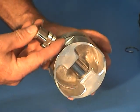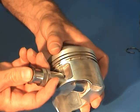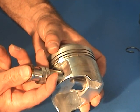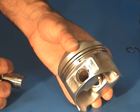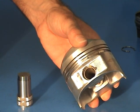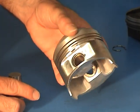Now, taking gentle pressure, firmly hold the plunger in place, and with your other two fingers on either side of the sleeve, pull the sleeve backward and the circlip is injected. Double-check to make sure that the circlip sits properly in its groove, and then you can go on to the next one.